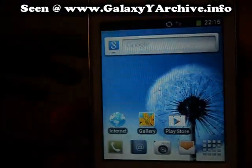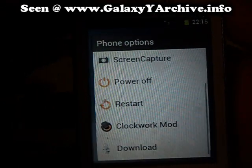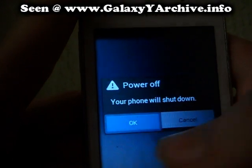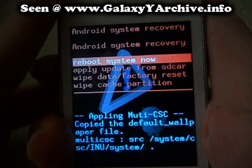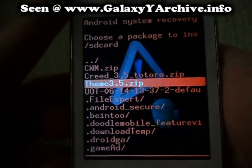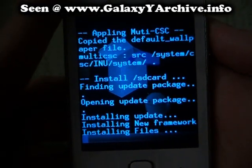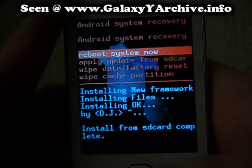That covers the CREES ROM features. Now, what we are going to do next is flash the ICS Trans Theme. We boot stock recovery again, choose 'Apply update from SD card', and look for the theme zip file. There it is. We choose install. Install from SD card complete. Now we reboot.